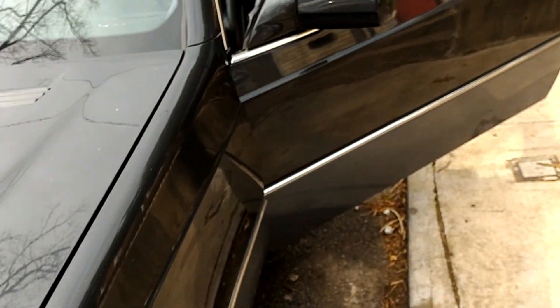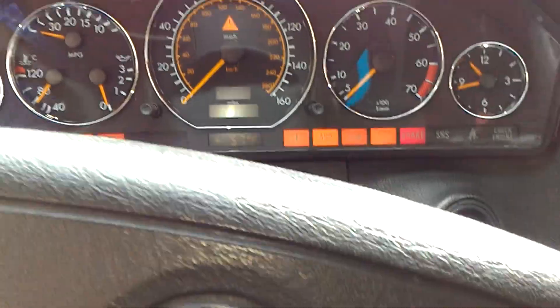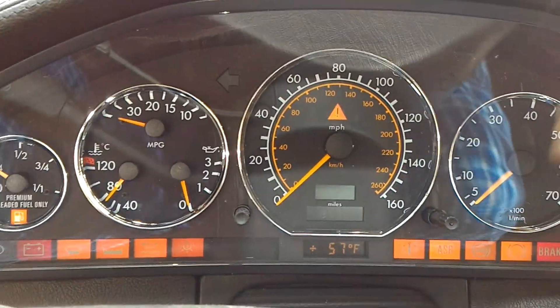Because the e-gas module should be in an SL vehicle, not an S-Class vehicle, cruise control won't work. But it will work in your SL.